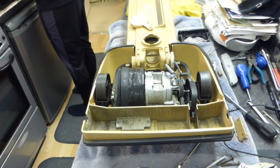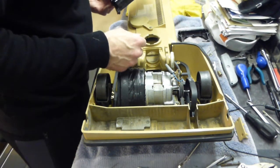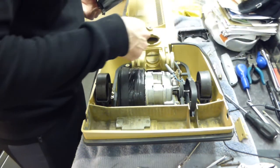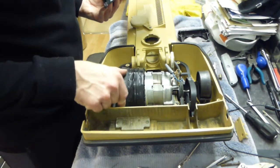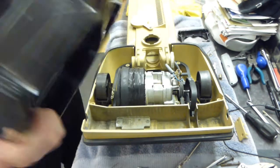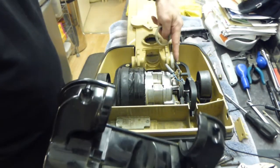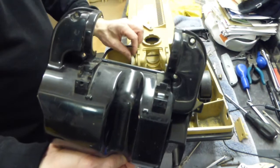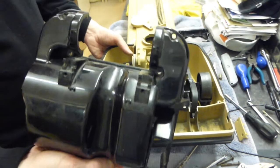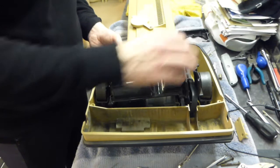I think it's the motor housing that we go on next. There's one spring that has to go on after — those two here are for the wheels. Just making sure I've got nothing else that needs to go inside before I put the motor housing back on the bottom. These here are going to form the other side of the lock to hold it on. So this is when I would put my little foam felt gasket back in, and then lower my motor cover back over those felt gaskets.